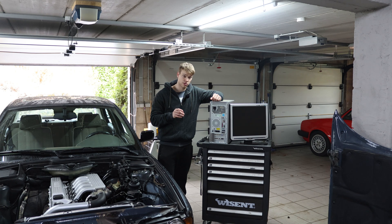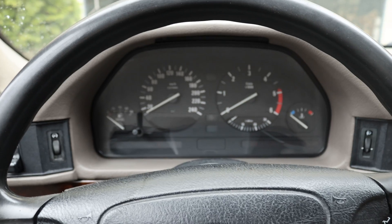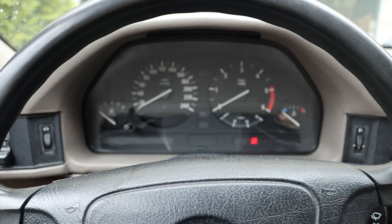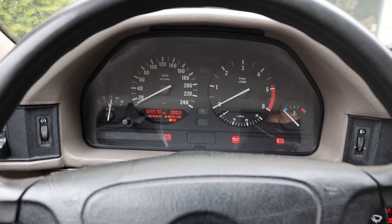First I'm going to show you what I'm trying to diagnose right now. I can't really adjust the injection pump because my dial gauge always shows the wrong lift and I have issues with the top part of the injection pump, so I need to set the minimum quantity of injection. I'm going to get the car outside and show you how it usually starts. The car is stone cold and hasn't been started today, so it's a proper cold start and it doesn't really want to start. I'm going to let it glow two or three times and then show you how it starts because it's not fun.